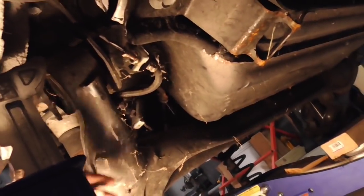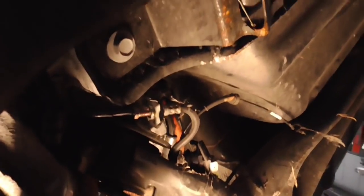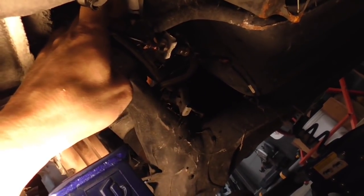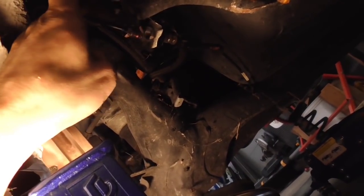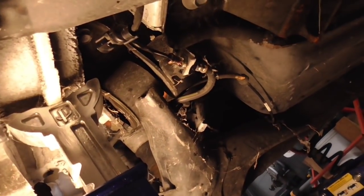So a little progress report here as we're taking the axle off. There's an ABS sensor you need to remove over here. Basically, just loosen it up and it mounts up right by the brake line. I've loosened up the 11-millimeter brake line right here. This is attached to the car, so everything from that backward is attached to the axle. We only have to disconnect at one location, and then do the same thing on the other side.